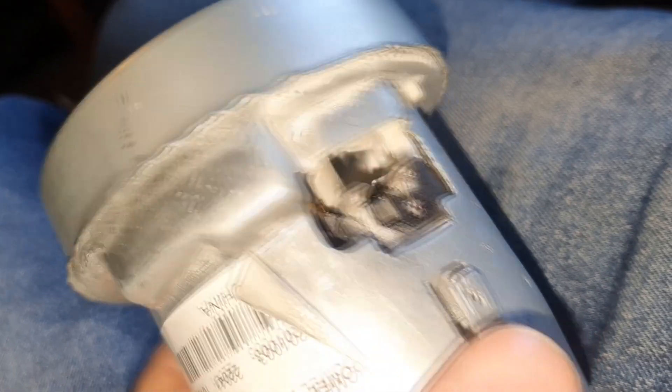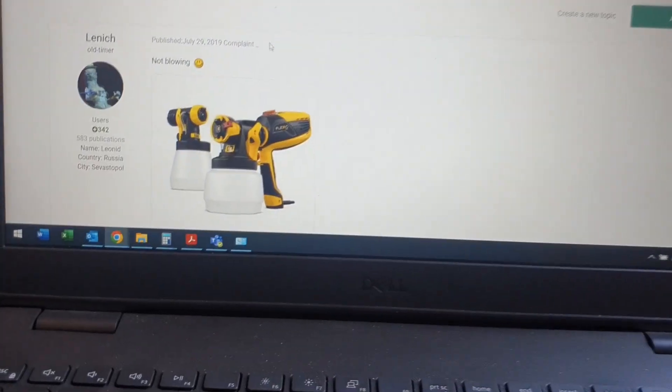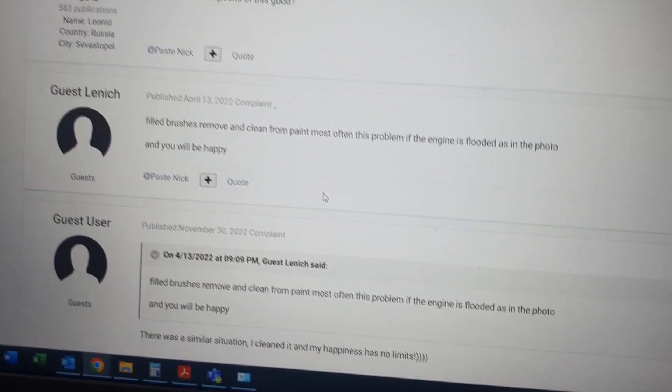Sorry — I forgot to turn on the external mic. To remove this one: just pop the little bolt under here, lift it up and pull upwards. Press the inside pin and pull upwards. Finally there's this connector. I figured out I need to remove the top anyway. One brush is here but the other is on the other side and I cannot reach it — I can see that the paint went to that side, which I can't reach. I was googling and found a page about a similar paint spray gun — same problem. The person had opened it up and fixed it by cleaning the brushes, which inspired me.